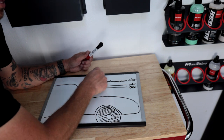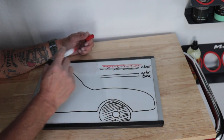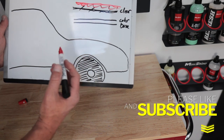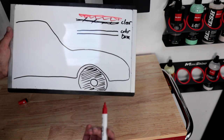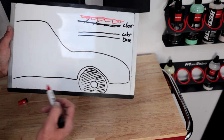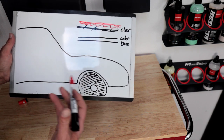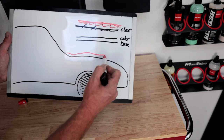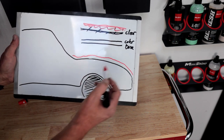On top of the clear coat is where your ceramic coating goes — it's adding another layer of protection to the vehicle surface. When doing a ceramic coating, we prep the whole painted surface very well, removing imperfections from the clear coat. Some customers just want protection and ease of cleaning without removing all defects, but we still want to prep the paint properly before we apply the ceramic.